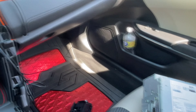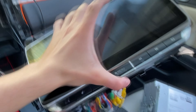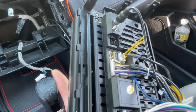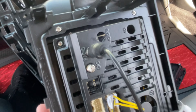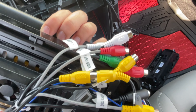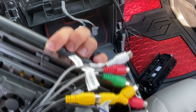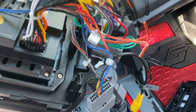What you do need now is the new screen. As you can see it's much bigger than what we had originally — you're getting a much bigger experience, especially for CarPlay and playing videos. I connected it before to make sure everything was working prior to starting this video. One major thing that was worrying me was all the wires, but you're not going to be using all of them. Here's a diagram on what you need to connect — the video output doesn't connect into anything, and a lot of the cables don't actually connect into anything either.